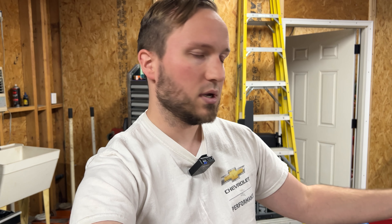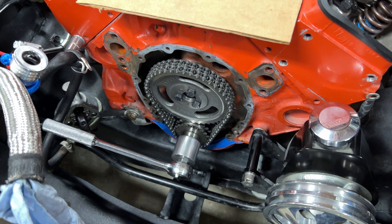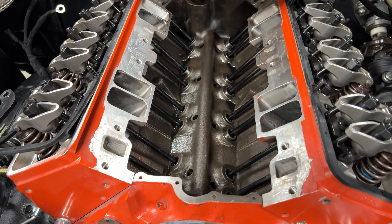Skipping ahead a little bit here — we have the new camshaft in. The gear is back on the outside. We have all of the push rods back in and replaced the ones that needed to be replaced with new ones. We got some other parts ordered that we're waiting on. We're going to do some cleaning in the engine bay and make everything look better before we start putting everything back together while we're waiting on the stuff to get delivered. We'll finish off this video once we've got pretty much everything put back together and check the engine to see if it cranks. Fingers crossed.